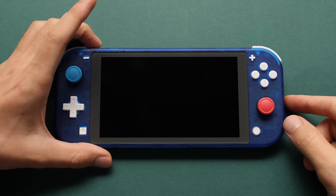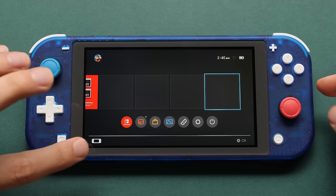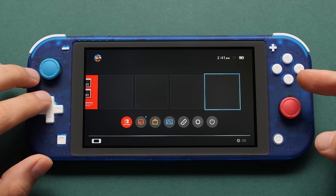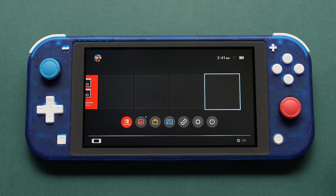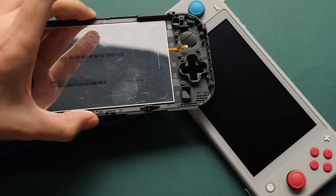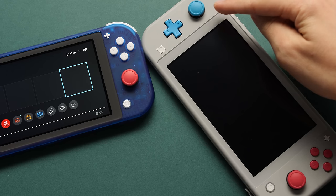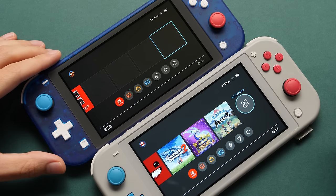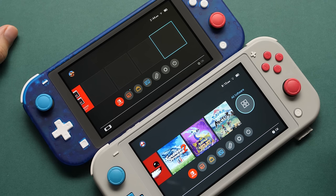This is an OCA replacement screen, which basically means there's no air gap between the touch panel and the IPS screen. In terms of quality, the panel isn't completely uniform — if I look at a pure black image, there's a tiny amount of light bleeding in the corner, along with an uneven centered image. I actually ended up doing two shell swaps for this video because I liked the display of the used Switch Lite I bought so much that I wanted to use it in my original Switch Lite. I still think the stock one looks slightly better because it's brighter.